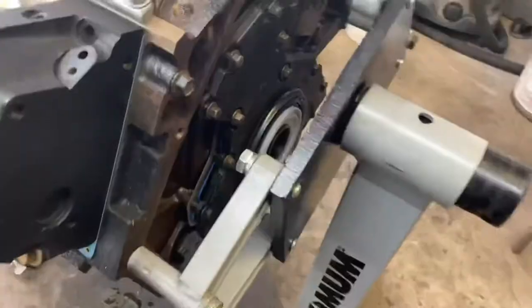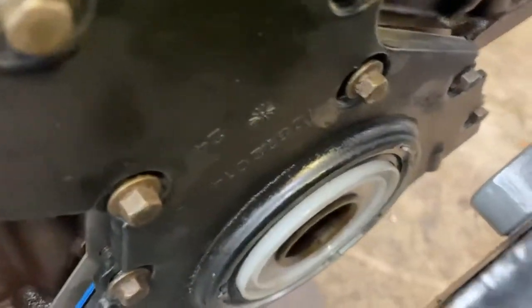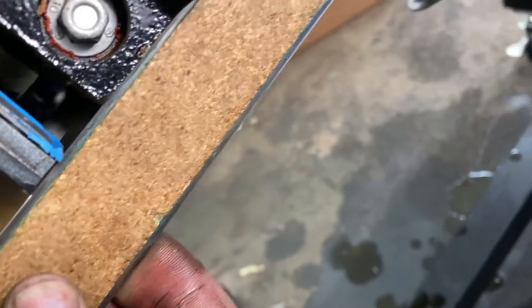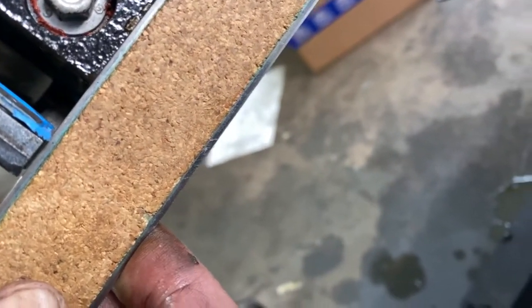Perfect — cheap insurance. Since I needed two hands I threw on the rear cover main seal. As you can see, that plastic piece that comes on the new main seal gaskets is to help align it up, but we're still gonna get under here and make sure that everything is perfect. Right now you can see it's a little bit too high, so we'll push it down and get her bolted in.